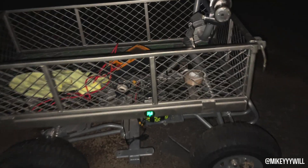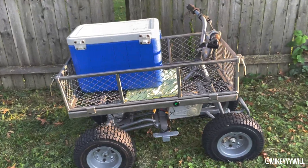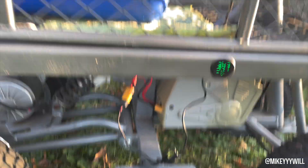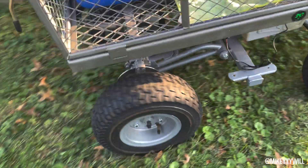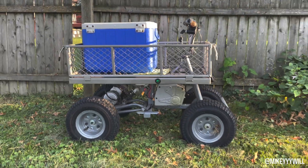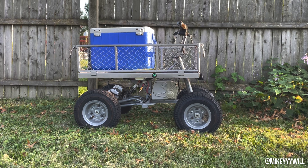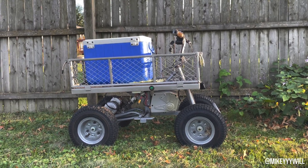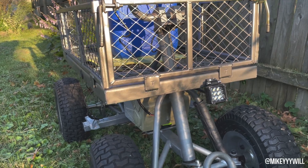Just to see it — and there she is. Got my multimeter on there because I was testing everything, making sure everything was good. There it is guys. These stock motors, when you get these kits, it's not completely finished — you do need to flip the polarity of the motor. Alright, so we are on, this does work, everything does work. Just need some brakes because the cable was super frayed. But look at this thing guys — came out pretty G. 10S, 40 volt, custom batteries on the inside of that little battery box. We got a little light on there too.